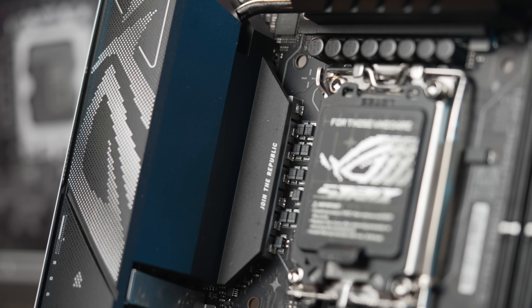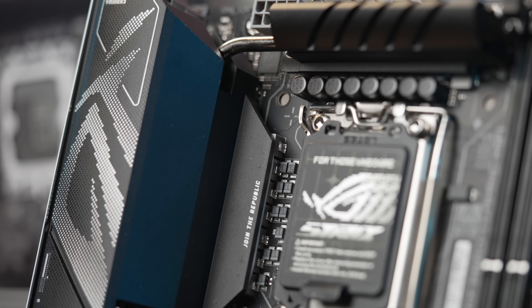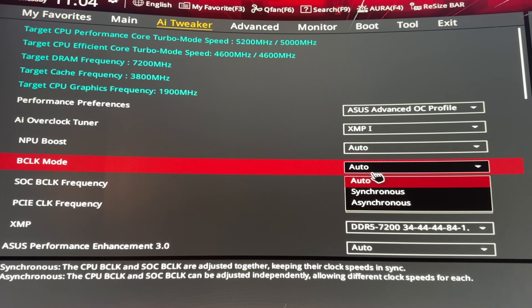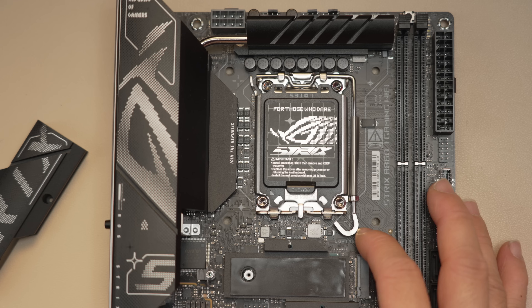There are debug LEDs at the top of the board. For power delivery, you have a total of 10+1+2+1 80-amp stages, totaling 800 amps for your CPU VCore — more than sufficient for most Ultra 2 CPUs at stock settings, which you are mandated to with this B-chipset board. One tidbit worth adding: this board has a built-in clock generator separate from the RAM. If BCLK overclocking becomes possible on non-K chips when they arrive, similar to some 12th-gen non-K scenarios, this board might actually be a candidate for that.